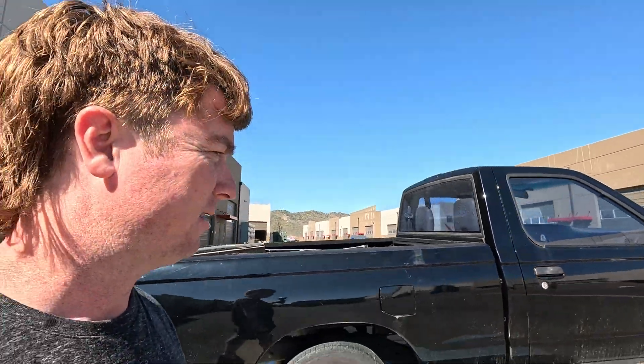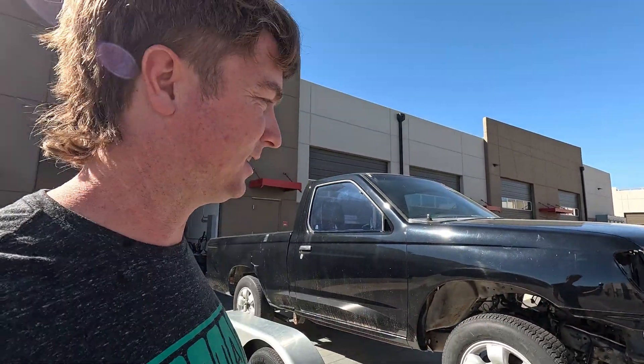The owner wants about 100 miles of range out of this truck, which I think will be pretty easy to do. It's extremely lightweight — mid-2,000 pounds, maybe 2,500, probably ending up around 2,900 but below 3,000 pounds. I'm pretty sure it'll have good power with the Nissan Leaf motor. That's the same motor that's in my Land Cruiser, and even that big truck scoots along pretty good, so this lightweight small pickup should go pretty good too. We might even get a higher output Leaf — the 140 horsepower version, or the 100 or 212 horsepower. We'll decide when the time comes to buy a donor vehicle. A hundred miles might be a stretch for a 30 kilowatt-hour battery, but I think with a 40 kilowatt-hour battery we'll definitely be able to get a hundred miles.